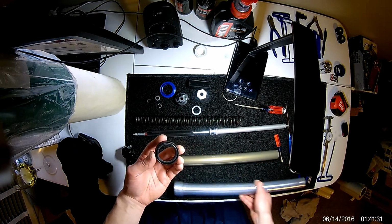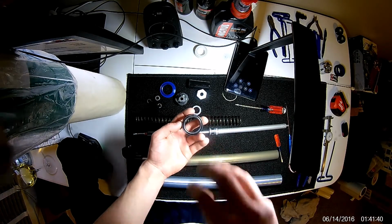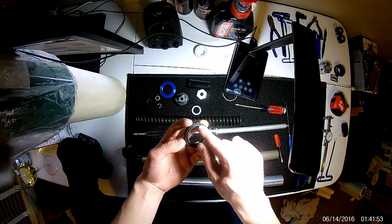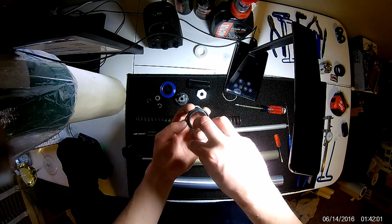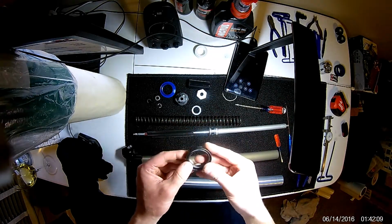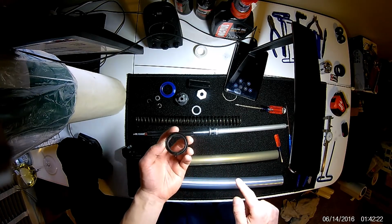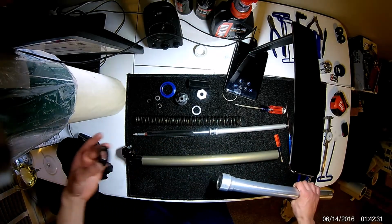So when you think about this, that spring needs to go on the inside. The best way I think about this is that there's not necessarily that much pressure inside that will act on this, because it's simply a rebound type damper. But if you think of pressure being on the spring, you want that pressure to go down into that ridge and squeeze the seal tighter so that it creates a better seal. If you have it flipped the other way, that pressure is going to want to push the spring out and leak all your fluid out. This is a very common seal used on everything. The seals on your car engine, on your crankshaft, your front and rear main seal, more than likely use this style. I don't know if I've ever seen a seal that doesn't look like this in that application. So the most important thing to know is to keep that spring on the inside.